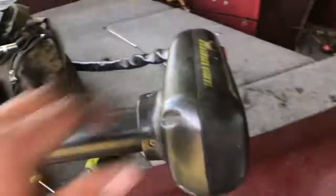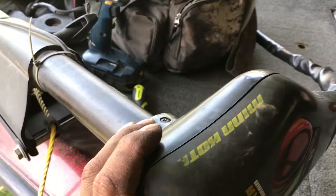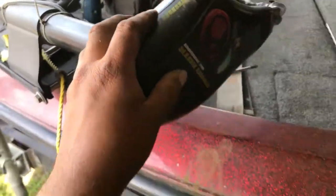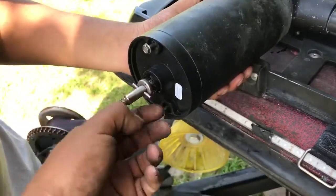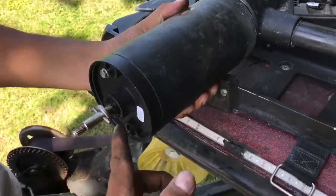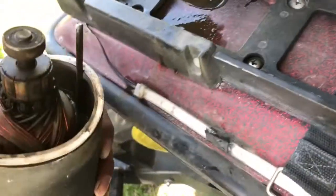Guys we're back at the house. Water was getting all the way up in the trolling motor and spewing out — we thought maybe there's a seal somewhere. We took this whole trolling motor apart. It was tricky to get back together because there's a series of gears and two cable pulleys. We got to the trolling motor head — right at the end of the shaft there was fishing line, just spider-webbed up in there. We cut it out, and then we noticed there was a seal right there — it's broken. We think the water gets in right there, because when we pulled the whole motor out, water just started pouring — like a cup of water. We poured it all out.